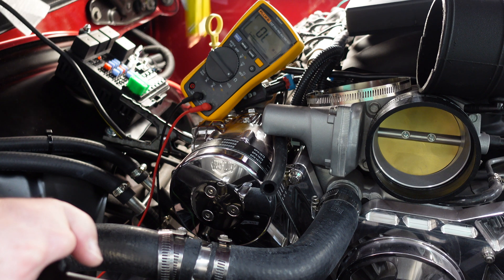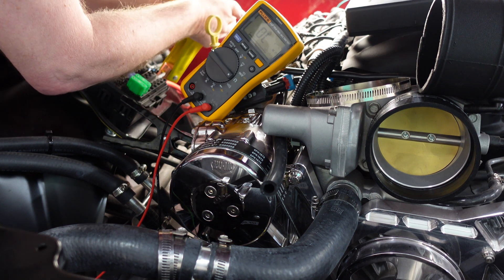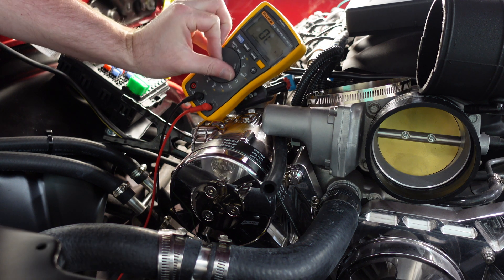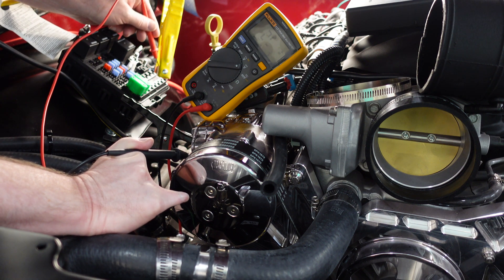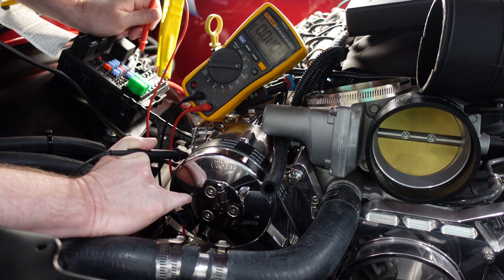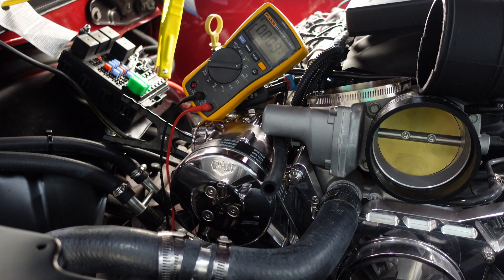Put this on the ground connection - not a very good ground connection, but okay. Now the positive on power. I don't have the battery connected yet, let me find a good way to get a clamp on there. Checking for sparks - no sparks. Okay, so I have power on there now and nothing bad is happening. Let me switch to DC on the meter - we have 12 volts. Checking these other guys - 12 volts. This one here has no voltage, but that makes sense, that's the hot leg.